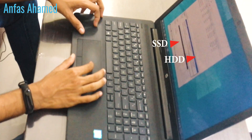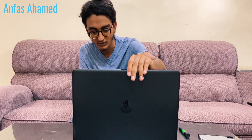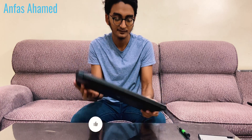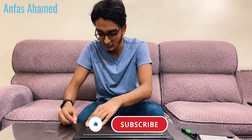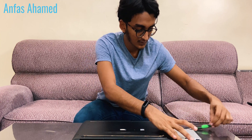Slowly open the laptop and switch it on. It's loading from the hard drive so it will be slow. We'll speed up the video. Let's check if the SSD is detected by going to Disk Management. Here you can see the 120GB SSD, but it's not yet allocated. Now we'll shut down the laptop before screwing it back together. Be careful when closing it — slowly close, then turn around, press the chassis down firmly, and put the DVD drive back in slowly.